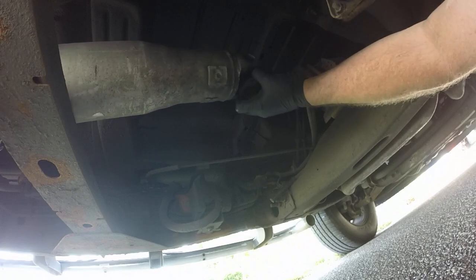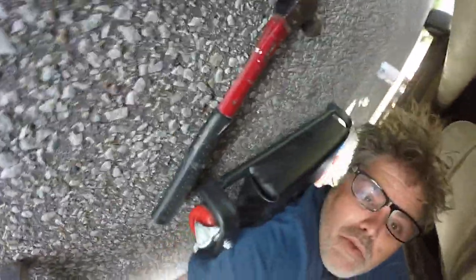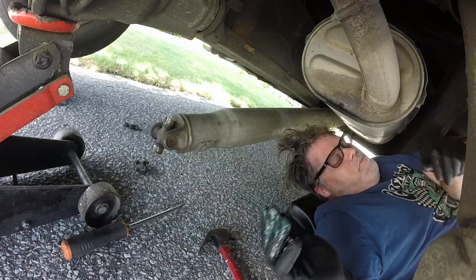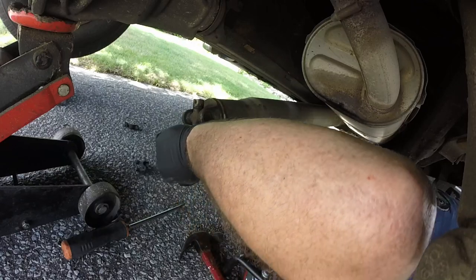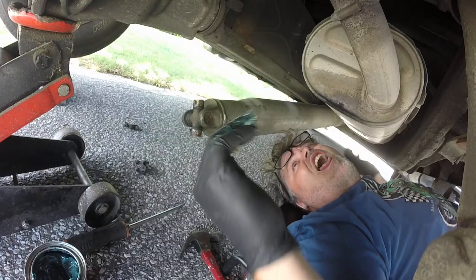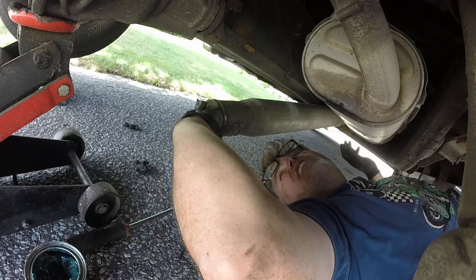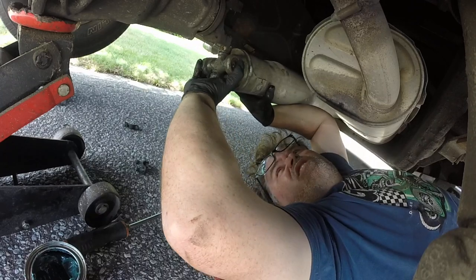Now I have to go to the back of the truck and try to slide the drive shaft the rest of the way in. Alright, let's go back under here — there's more room back here. I'm down to one hand because the other one's covered in grease. There she goes — she's in. Let's get some more of that grease, stick our fingers in and put some in and around it. Now we'll slide this back up, turn it to neutral and slide her in.